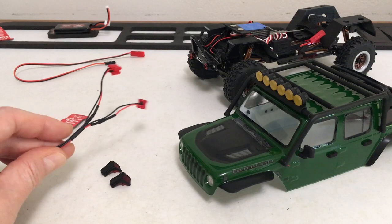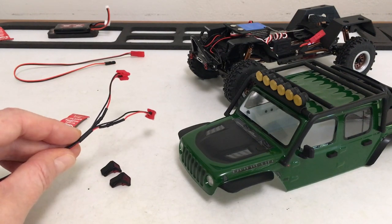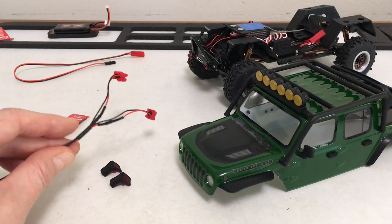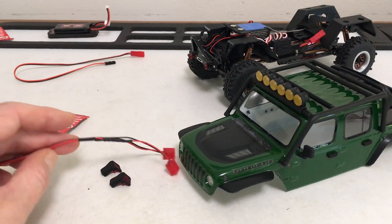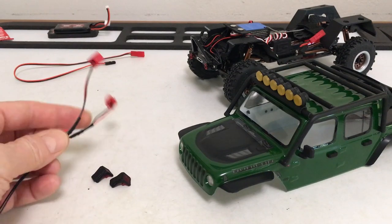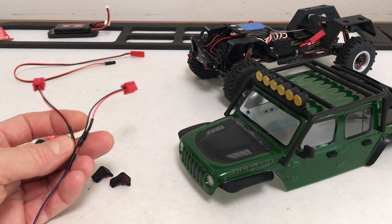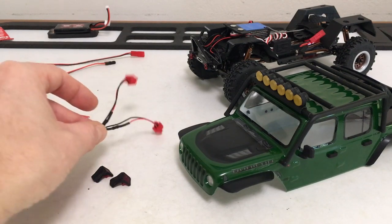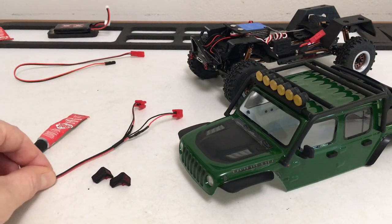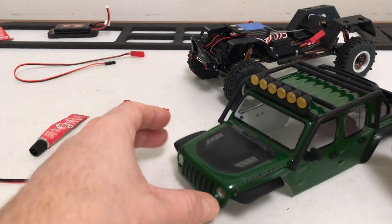And then I think I forgot to mention this, when I made this little whip to bring these together, I like to put some shrink on there, but not shrink it so it's loose, so you can actually slide this up and down the wire way. So that kind of helps with wire management and bringing headlights or taillights together and then routing them. So just a little tip there to pre-think something like that. So we're going to get those in.